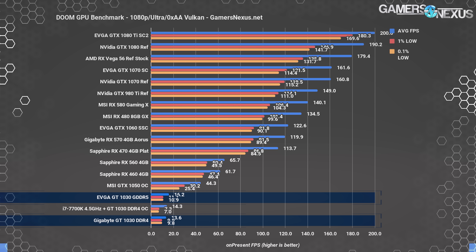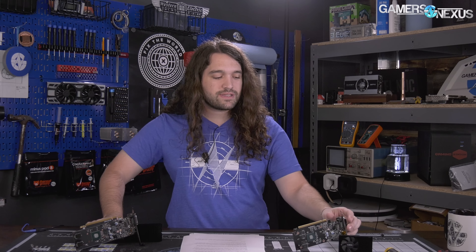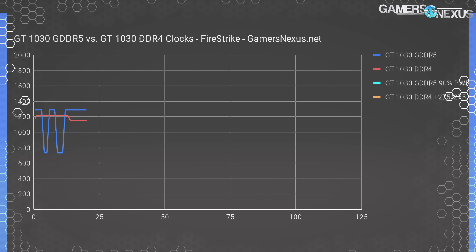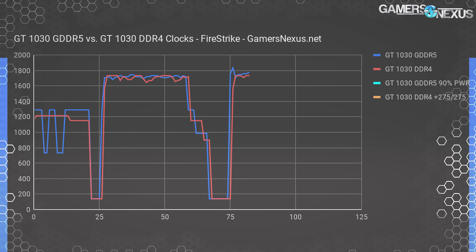It's time to analyze the clock differences. In most previous benchmarks, the DDR4 version was overclocked and the GDDR5 version was not — we didn't need to overclock the GDDR5 card. On the DDR4 card overclocked with at least a 250 MHz offset on both memory and core, it was never close to catching up to its GDDR5 counterpart. Using Fire Strike we can show why it's crippled and in what ways it can attempt to catch up. The first two lines are the GDDR5 and DDR4 GT1030s without modifications — they're fairly close overall, with differences never exceeding 30 MHz, confirming a good clock-for-clock test.